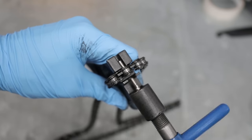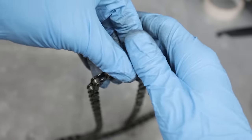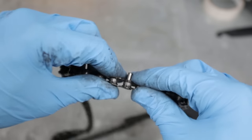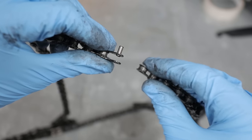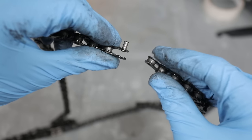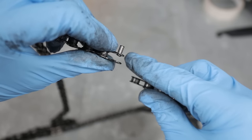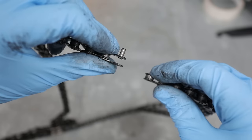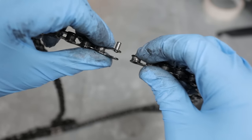You will feel a bit of resistance as it gets towards the end. Back off the pin and take the chain tool out, and our chain should with a bit of wiggling come apart. This is the center bit I was talking about — we just have to push the rivet clear enough of that so it's still stuck in this plate. To reattach, we simply push the pin back through using the chain tool in a reverse manner.